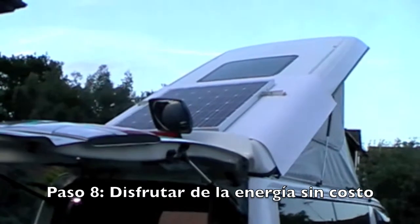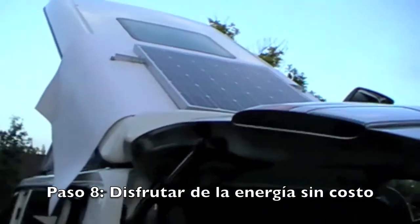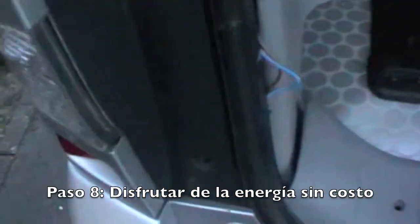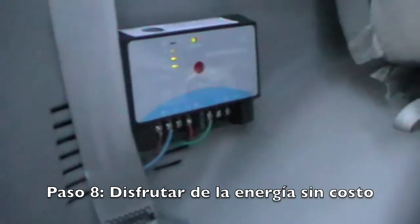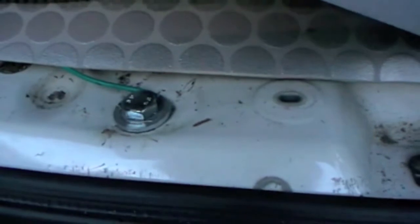So there we have it: panel on the roof with the frame, and then down the side of the roof. Down the side here comes the wire, then goes in underneath here and around the back. The wires come out of the vents into the charge controller. From the charge controller you have the plus wire going into the plus wire that goes around the body of the van — there's a ripple here — and then the grounding is done here, and then it comes to the negative.